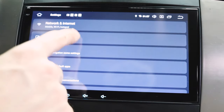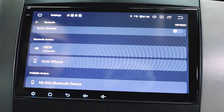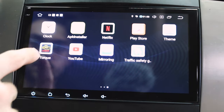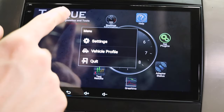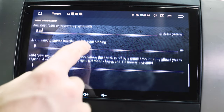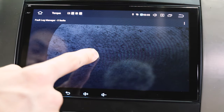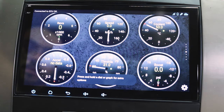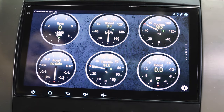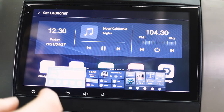You can also get this — this is an OBD2 scanner, which you plug in right below your dash right here. Now go to settings, go on Bluetooth, it's refreshed. Go to OBD2, press yes, and pair. We are now connected to the OBD2. Go home and open OBD2. Go to settings, vehicle profile, set your profile — Tahoe — next. Now we can go on fault codes, scan — no faults because I take care of my Tahoe. You can see all the real-time stuff.